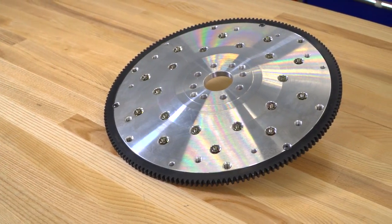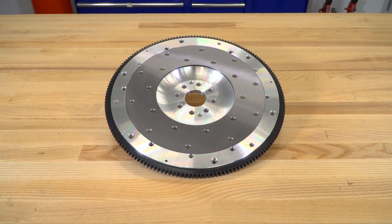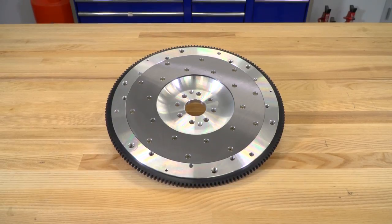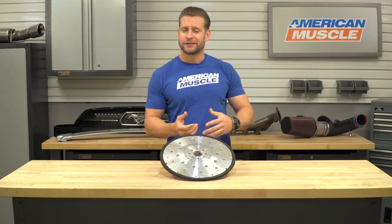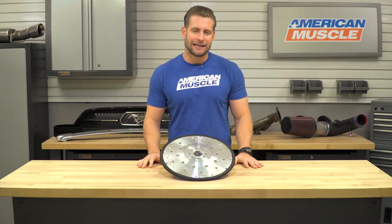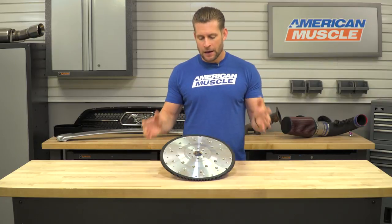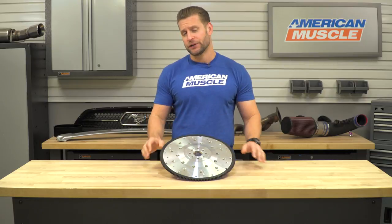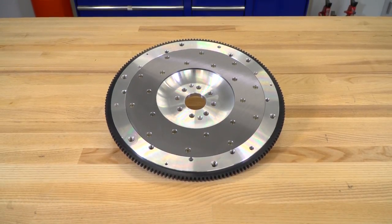The argument between using a heavier steel flywheel and a lighter aluminum or chromoly flywheel is not exactly a new one. The general rule of thumb is that the heavier flywheel is gonna be beneficial in two big ways: first, it's gonna be great to get a big heavy car moving off the line thanks to inertia, and it's also gonna make the car feel a little easier to drive in stop-and-go situations. Other than that, lightweight flywheels shine basically everywhere else. I'm a big fan of removing rotational mass — I think it's nothing but a plus, and switching to the aluminum option from McLeod certainly does that.